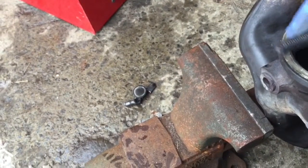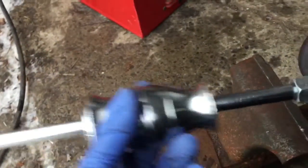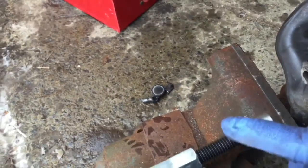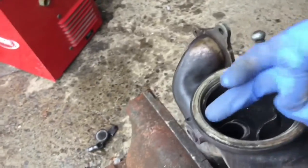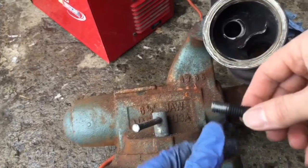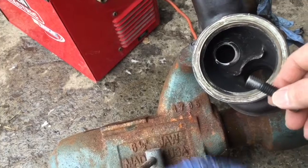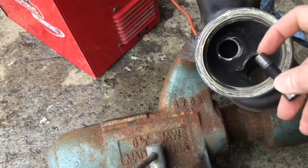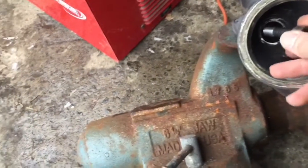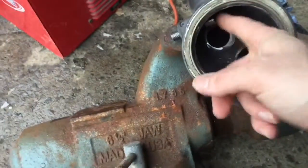So this is gonna be slid from inside the bushing. It's gonna be screwed in there. And then we're just gonna slam it out with this thing. So I'm just gonna cut the bolt shorter so I can slide it from inside, and then I'm gonna show you. Okay, so cut the bolt to make it shorter. I made a bit of a 45-degree chamfer here to make it smooth to enter, and then use a die to rethread it. So this is why it looks like the black is off. So insert the bolt in there.